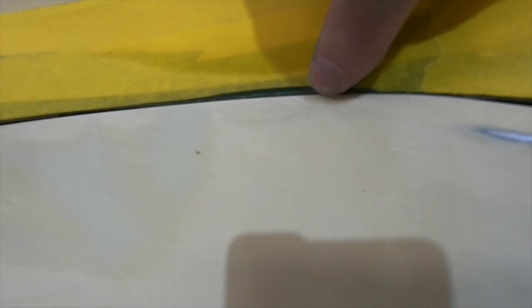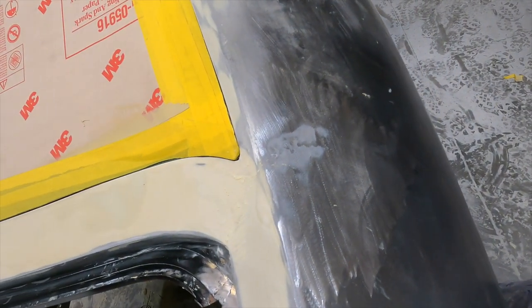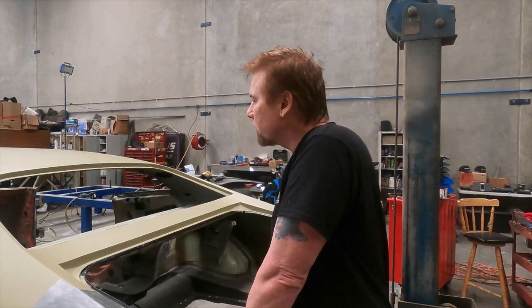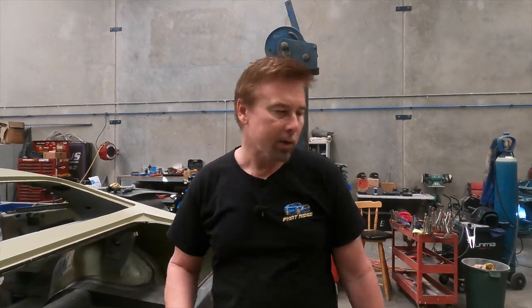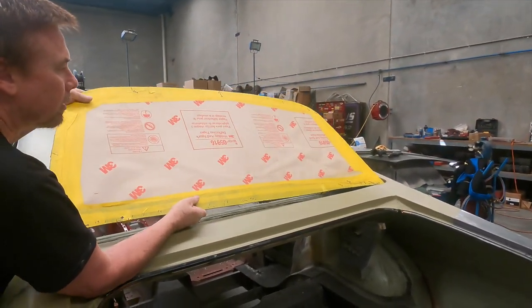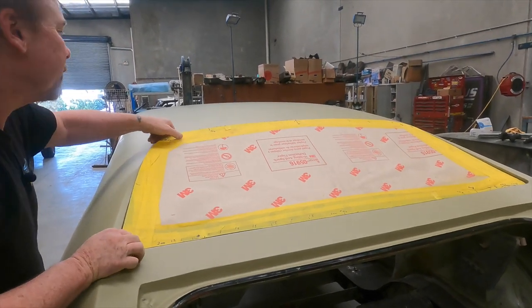As I approach this curve here, the tape's actually ripped off the glass so just ignore that. But when you get to here it's actually touching so it's fairly hard up there. It's just fine tuning — you've just got to be patient. We've finally got this rear window frame wrapped up. I adjusted little increments here and there with a bit of filler, put it in some epoxy primer and it's looking fairly good. So we'll just grab the glass, throw it in and see how she looks.